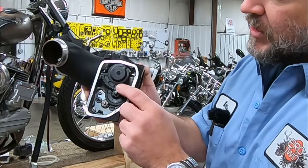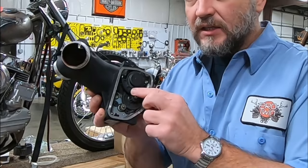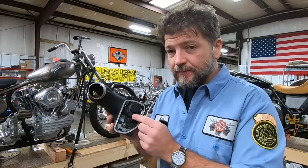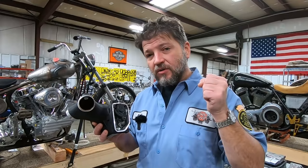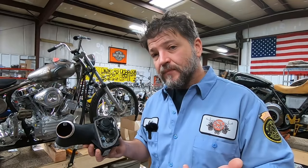Where throttle blipping becomes an issue is that you have most of this backlash with no tension on the gear. When you're blipping the throttle over and over again, it creates an impact area on the first few teeth inside the throttle body. You also spend most of your time at five to ten percent throttle, so these first four or five teeth get most of the wear and most of the impact. When you tweak the throttle and it slams back down, you can hear it. Over time, these teeth can actually break, and when they do, you get extreme throttle lag down low. Unfortunately you can't see this without taking the cover off — and the cover is what contains your throttle position sensor.